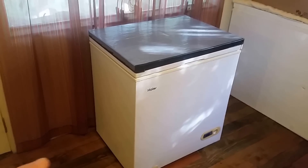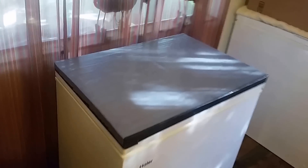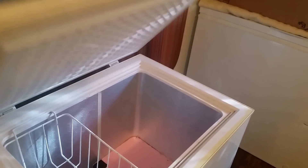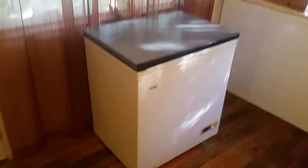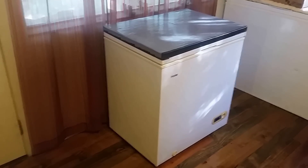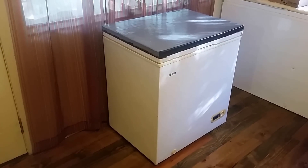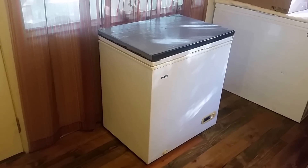This is a chest refrigerator, and when you open the door the cold stays in the bottom. When you open the door on an upright refrigerator, all of the cold air flows right out the bottom and before you get it closed you hear the compressor start again. So with 200 watts of solar and a chest refrigerator like this one, you would be fine charging laptops and having LED lighting at night with power to spare.